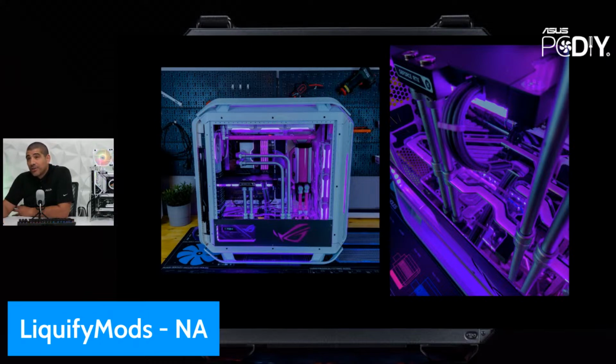I recommend to users, if you can, try to keep within a maximum of 2 DIMMs, even if you go with dual rank. Dual rank will still be lower in scaling than single rank, but if you can do that, you'll generally be able to run higher scaling. But in either scenario, you're still talking about a very performant system, right?